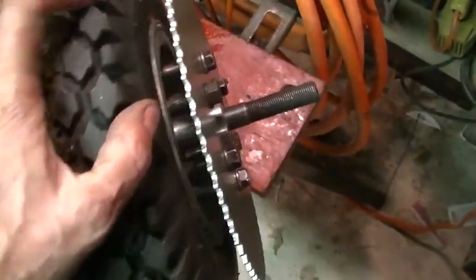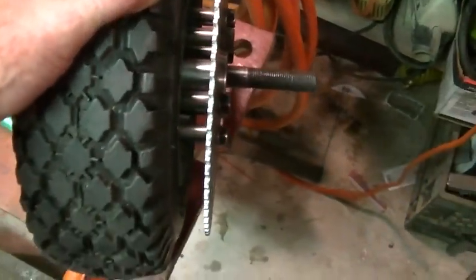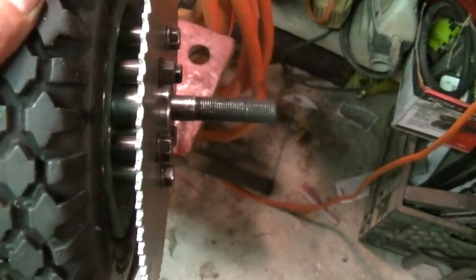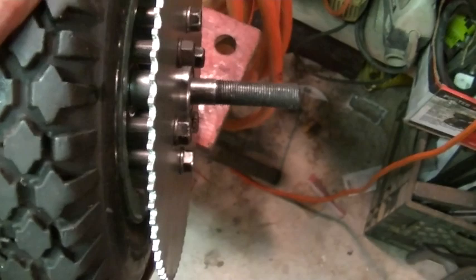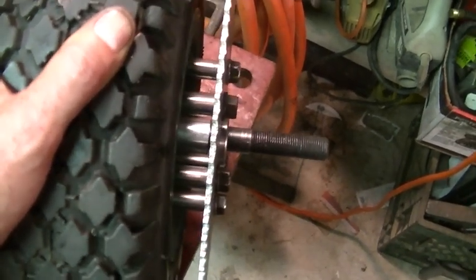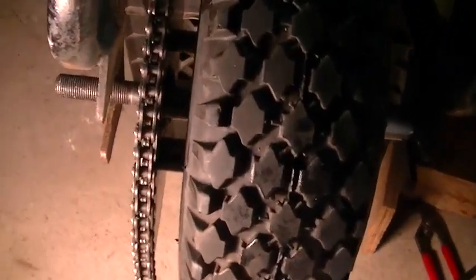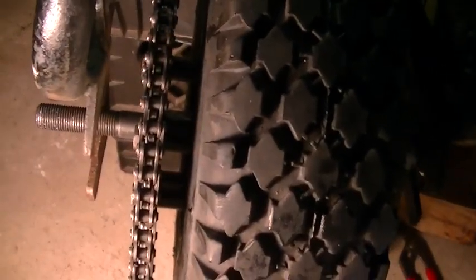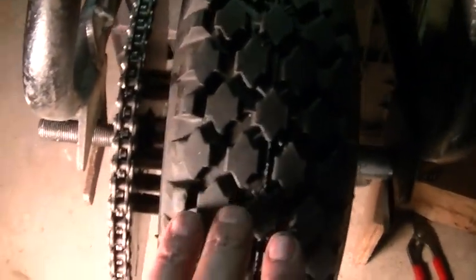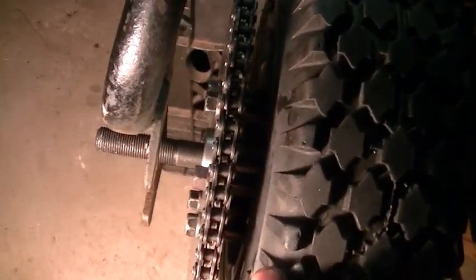Let's snug them up. I gave it a spin and the sprocket is a little wobbly, so we're going to have to work on that a little bit. It also looks like there's still a tiny bit of space with that spacer in the bearing, although maybe it's sitting on the inside. It needs a little more refinement. I'm going to put it on the bike right now just to kind of see what things look like. As I get these spacers all the same, that's going to take a little work. Kids, don't try this at home - just go buy a new wheel, or actually go buy a whole new mini bike. But we'll get there.